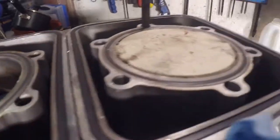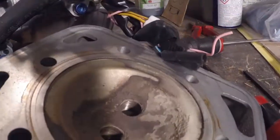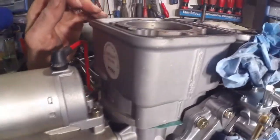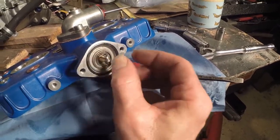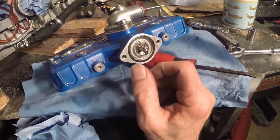Did we have a leak there or not? I don't think so. Seals all look quite good still — maybe it was just a bit of friction between the bits of aluminium. So the job for tonight: let's do some head polishing. I'm going to turn this engine block upside down and let all the water drain out of it before I loosen the cylinders. I sort of expected that thermostat to pull out of there, possibly with that seal. Don't really want to go digging around, so if there is a method for this it would be nice to hear that before I start levering things. I'm going to leave that for now and concentrate on cleaning the head up.